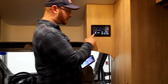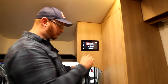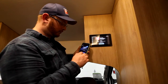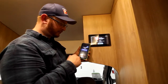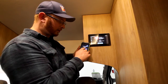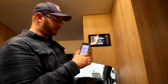If you hit the little cogwheel here, you can come to your settings screen. You have 24 and 12-hour time, auto dimming, and a push for mobile app. The mobile app is Vega Touch. Open the Vega Touch app on your phone, hit scan, it's going to come up with this unit. As long as the number matches, double press it — it says connecting. Once that's done, you're going to see authenticate, push numbers there, type in the numbers shown here, and then hit authenticate. That's going to load the floor plan. Sometimes these need an update, so you must make sure you have your phone connected to data to allow the system to be updated.